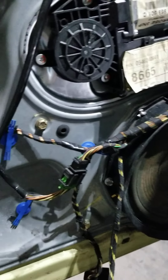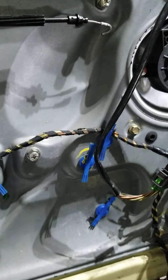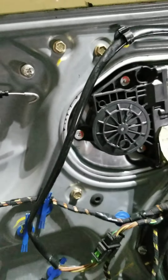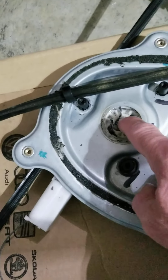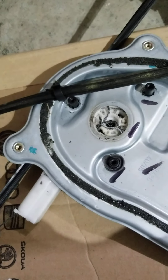I'm going to give you a couple of hints on how I had to get this done. I made the mistake of putting this together, putting it on, and trying to get the window in — and that didn't work. I had to take the panel back off. I left the motor on the regulator because if that piece pops out, it's going to unwind, and the tension on these cables is very tight.